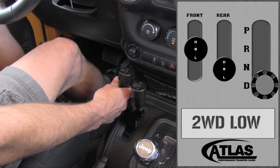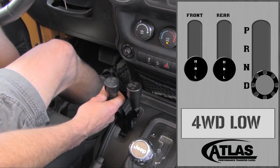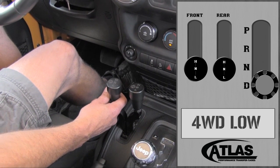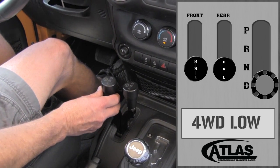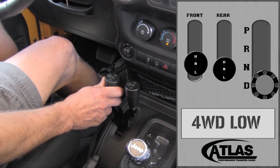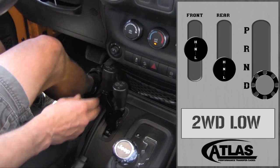At any time, I can take the front axle and do the same thing I was doing in high four wheel drive — basically engage and disengage with the transmission in drive. Push some gas in there, let off, and shift it out.